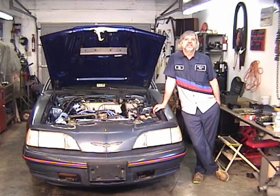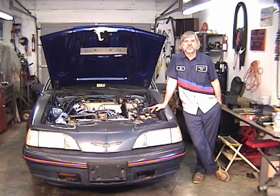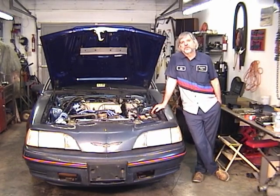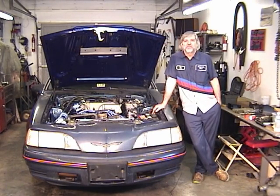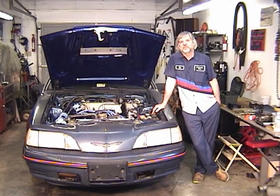Okay, what is needed to get the engine to start? You need 3 things. You need compression, you need fuel, and you need spark. Now, the compression is, obviously if the car has been running before and you just went in to, like I say, eat lunch and you came back out and it doesn't start, well, it's probably not compression, the thing had been running before.